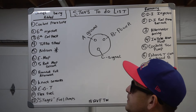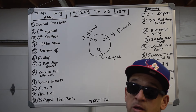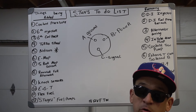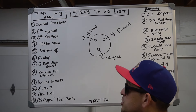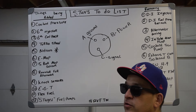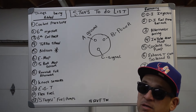There are a lot of safeties and fail-safes in the ECU. Nitrous is another great feature — George wants to be like Stav. The ECU has a progressive controller so that'll be fun. EMAP back pressure — we'll know exactly when we're pushing the turbo too far, which could cause motor failure. Five bar MAP sensor for the amount of boost we're going to be running so we don't have any limitations. We're also wiring in a resistor for the alternator — the 2018 RS3 uses a digital signal and we're converting it to an old analog-style signal.